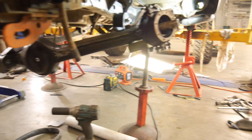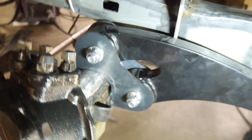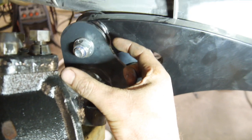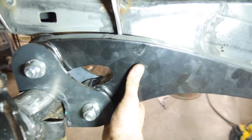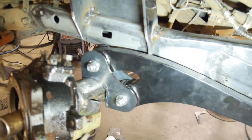So this is where we are at — I'm in a bit of a pickle. The coilover mounts are in and now it's time to get the radius arm brackets tacked up to the axle. But the problem is I don't know where to put them because I don't know how bulky the shock is before it steps out to the two-and-a-half inch overall diameter with the coil. It's a two-inch body and the coil is roughly two-and-a-half inch OD. I want to have it as wide as possible so it's going to clear the chassis. This needs to rotate over, so I need to have it all tacked up so I can put the axle through its articulation motions to check.